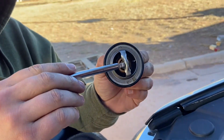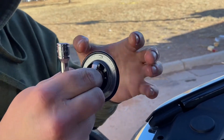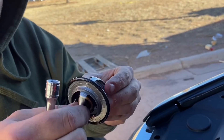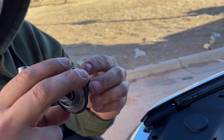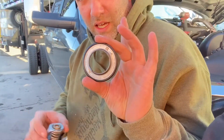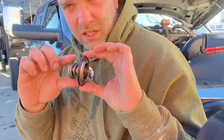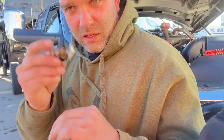Basically these two arms, and the small triangle — you don't have to cut that, you just gotta open it here. Open this thing so that the valve or whatever is holding the shaft, you can pull it out. If you want to cut it you can, it's up to you. After that I'll show you the final product. What we ended up doing is pulling out the thermostat and using a little bit of persuasion to make it end up looking like this — it used to be kind of like this, now it just looks like this.